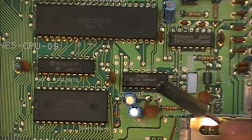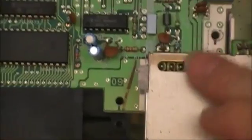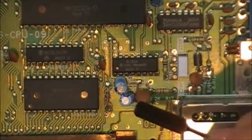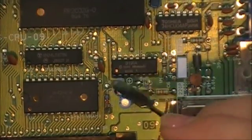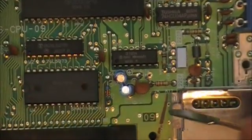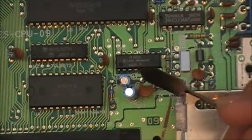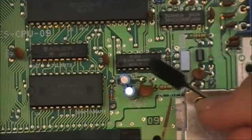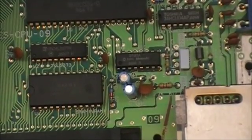And there is the motherboard. The lockout chip is the one labeled 3193A. It's at the side of the board with the video output and the power input. There are three capacitors right in the way because we need to get to the 4th pin from the left and cut that pin and lift it. Some say it needs to be grounded, but apparently it can be left floating and still work just fine. Either way it should keep that chip from resetting the machine over and over again when it doesn't get the code or whatever it's looking for.